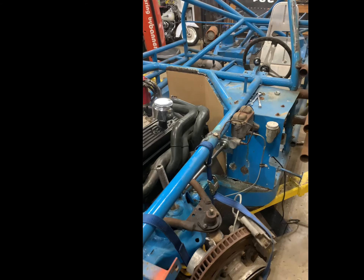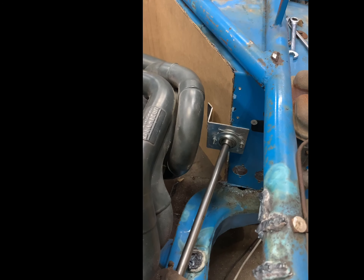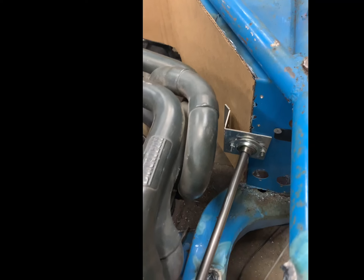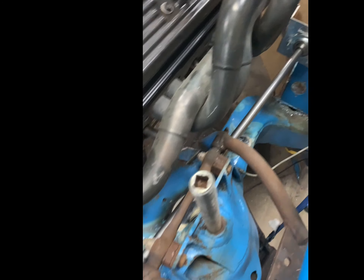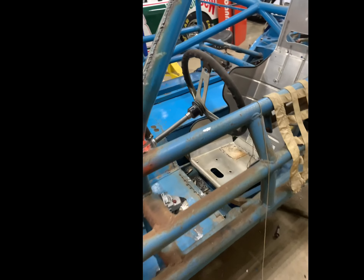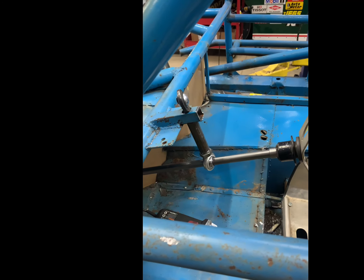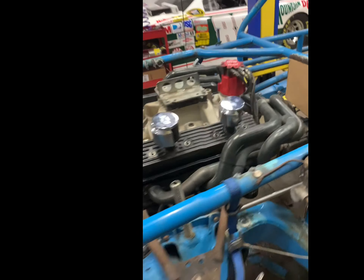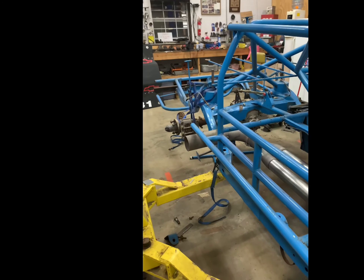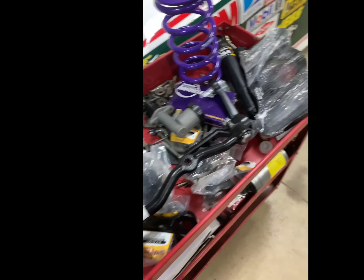Welcome back YouTube — it's been a very productive day. We got the steering system in and I came up with a bracket down there to take care of the firewall clearance issue. Once we get the new piece of steel welded in we'll bolt that in on both sides and that will be enough to support the firewall bearing. Had to heat the frame up just a little bit to get clearance there. We actually got the steering wheel in, measured the distance to the seat — that's similar to my 88 car and a comfortable position. The height looks good too. Exhaust is done. Tomorrow I'll tackle the rear end — I have a new quick-change pan-hard bar bracket that came in.